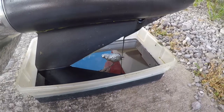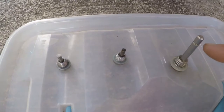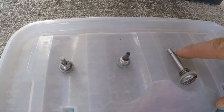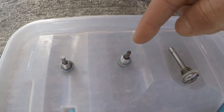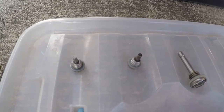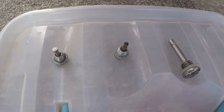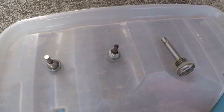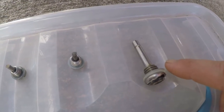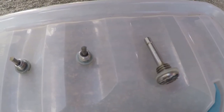Okay, while that's finishing up on the drain there, let's talk about these plugs. The only thing to note on the level plug is when we refill it, we need to make sure we get it all the way to the mark. The drain and fill plug are identical. I did have a few metal shavings, but keep in mind this drive has both dog gears and U-joints. A few metal shavings are not really alarming. And lastly, I just want to note this is a reusable neoprene washer. These are great. If you've got the original rubber washer, you probably want to replace it.